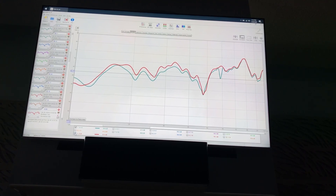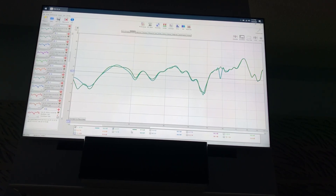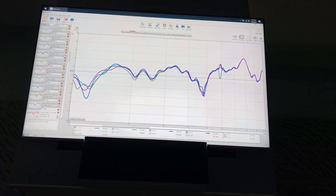Virtually identical. Let's turn on the other lines and go through in series — this is turning the AVR up and the sub down. As you can see, everything is just overlaying. One or two dB at the most difference here and there, and it comes and goes, crossing at different points. This is just nothing. So boom — I would say that is pretty convincingly myth busted that going one way or the other makes any difference whatsoever.